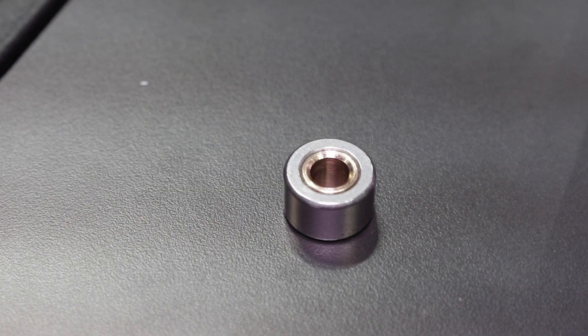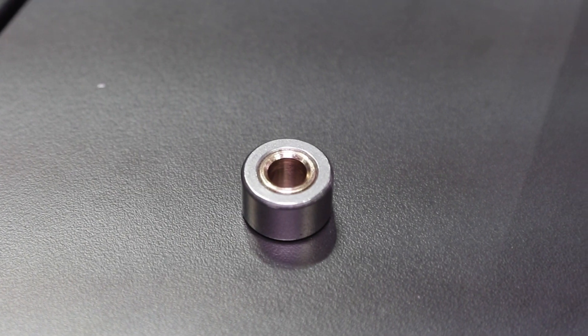And these do not have needle bearings, correct? No, they don't. They're all bush. They use a proprietary bronze alloy bushing, which makes them much safer than a needle bearing lifter. So in the event of a failure where you would have needle bearings all throughout the motor, you don't have that to worry about with these.